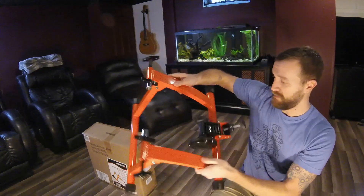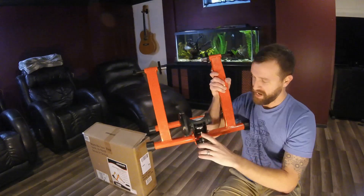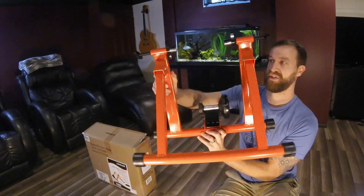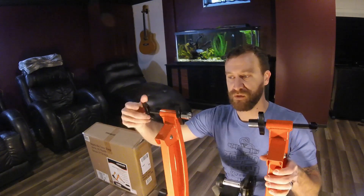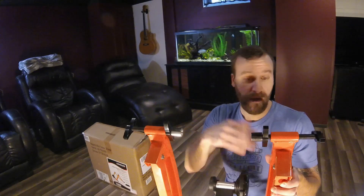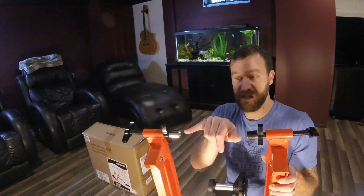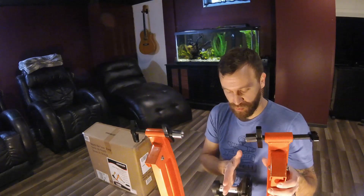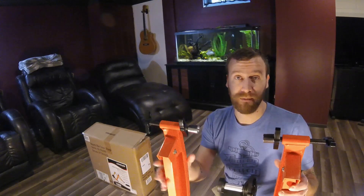When you're ready to use it, it just pops out like that. The magnet itself just kind of flips back and sits on this adjustment screw — that's kind of how it'll look when it's set up. As far as putting your bike in it, it's got these two cups on adjustable screws. You either take the quick-release they provided, or if you have a bike with standard axle nuts those fit in as well. You basically center those between the cups, run them down, and once they're tight and your wheel is centered on the magnet you should be good to go. Really easy setup — should only take a minute or two.